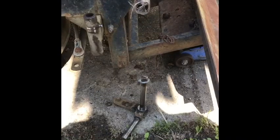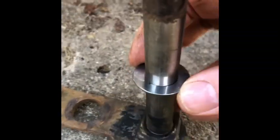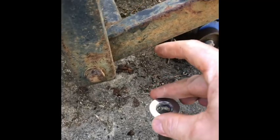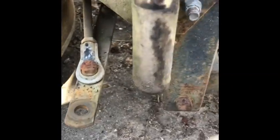She's all cleaned up. I took the old thrust washer off the bottom so there's nothing there now — just metal. One of our flat washers goes on with a decent dose of grease on that, then the bearing, then the other washer on top. This does have a grease nipple here but I don't have my grease gun, so we'll just give it a healthy grease on the kingpin and that should do it.